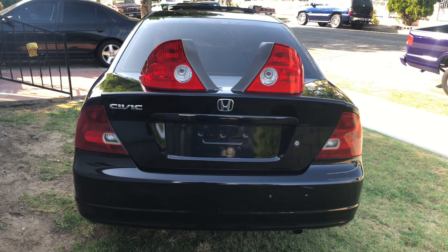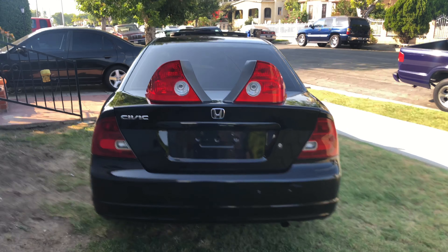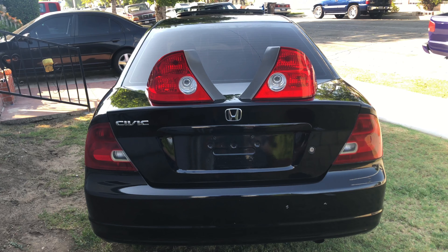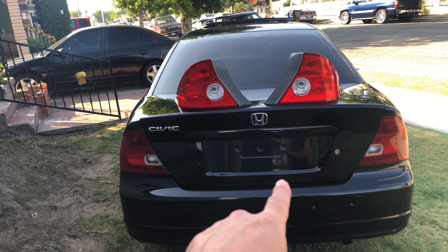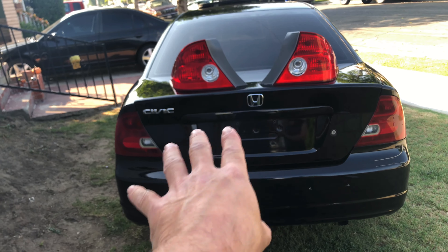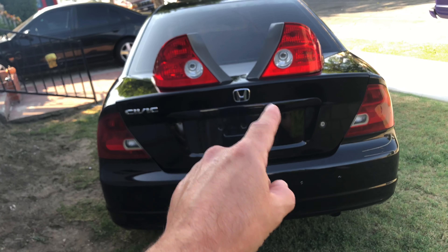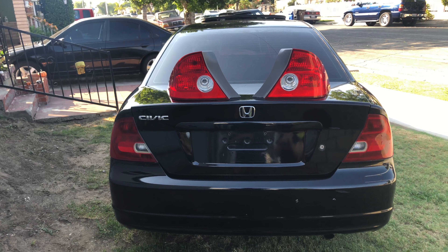What's up? It's Johnny. Today I'm going to show you how to do a conversion on the taillights from a 2001, 2002, or 2003 Honda Civic to 2004 or 2005 taillights. The taillights on this car are the ones that come on a 2001, 2002, and 2003 Honda Civic. This is only for the coupe, not the sedan — just the two-door car like this one. In 2004 and 2005 you get the lights up top. These lights are shaped the same, so if you remove the old lights you can slide the new ones right in. But these lights have four light bulbs and the sockets don't fit because the light bulbs are bigger, so there are a few modifications you need to do. It's not hard — let me show you how to do it.